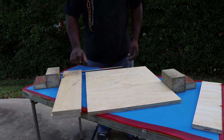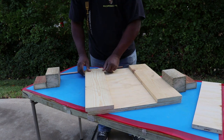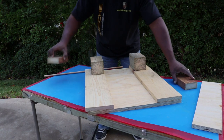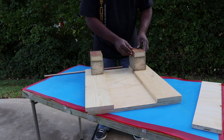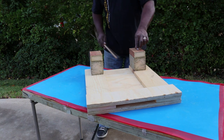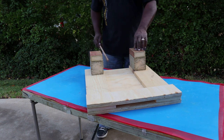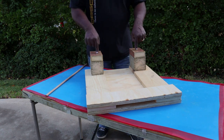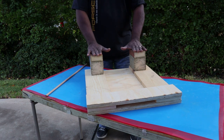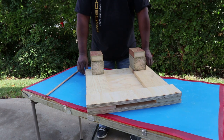So this is how it looks when you put them all together. I think the most critical distance is from inside to inside, which is 9 inches. I've seen 3 or 4 different designs and each time this inside dimension was 9 inches. I'm not sure if there is a load that falls on these — I think these are for some kind of lateral support, and there may be a load on them. I've seen this height and I've seen higher. So in a nutshell, that's how you make a cradle for holding the engine to lower it.